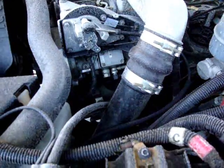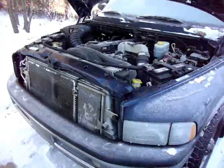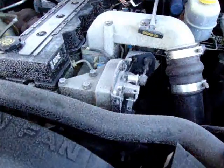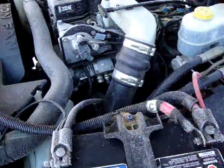After doing more research, I've come to the conclusion that the electronic module on my VP44 injection pump is acting up. Many of you already know that the VP44, built by Bosch, used inferior solder within the module, which will degrade over time and cause circuit board issues, resulting in a malfunctioning injection pump.